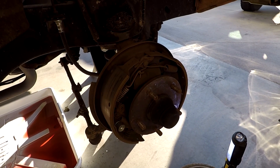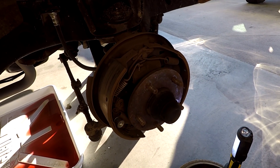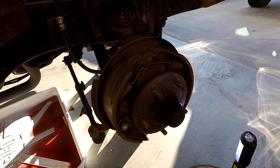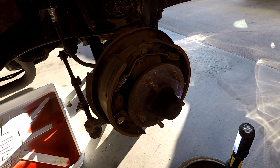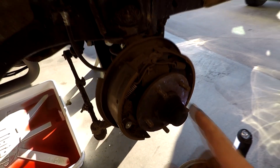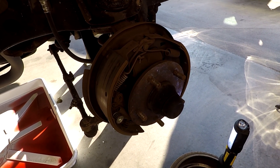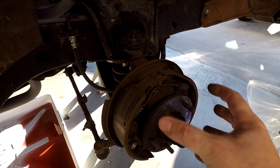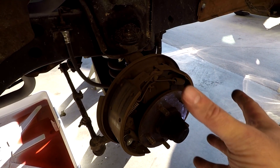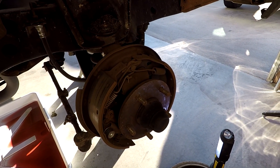Lastly, I've got to get rid of these drum brakes. They work and stop the car fine, but they always kind of grind or squeak or make noises. In my case, the passenger side always grabs harder than the driver's side, so the car always kind of pulls left. When I come to a stop, that side is under more rotational tension, and when I let off the brake you can feel the pressure release - it's like it's binding up the suspension a little bit.